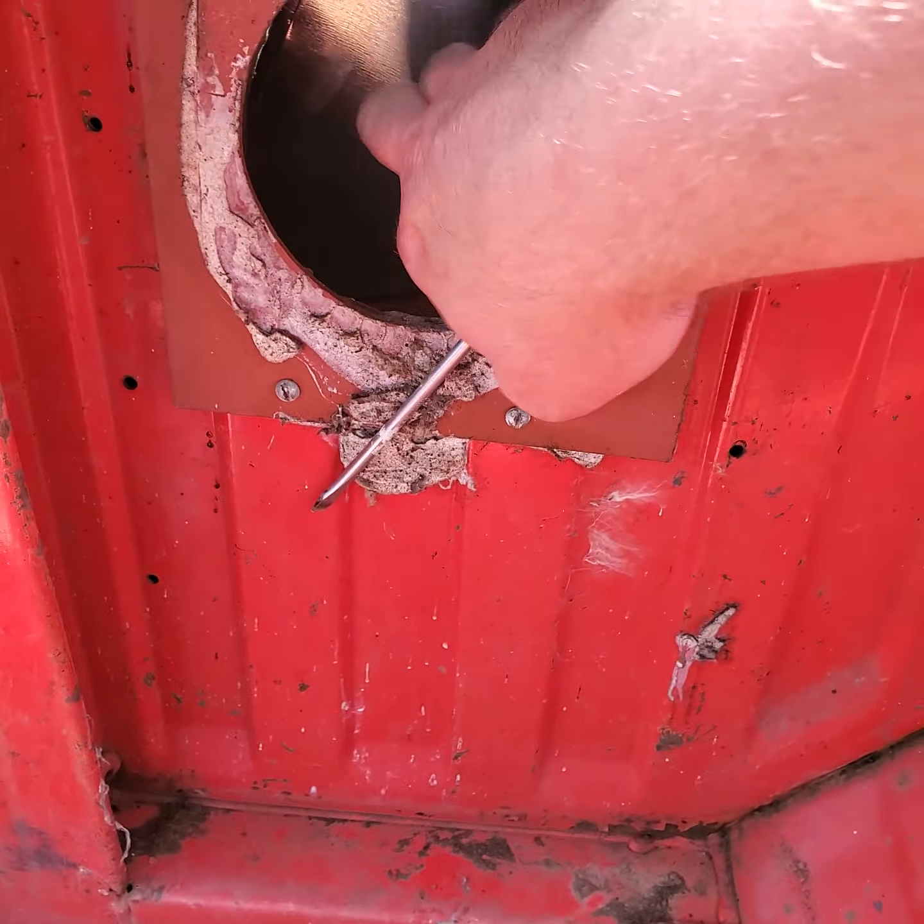There are actually stick-on floor pans, so I'll cut all that out, put the floor pans in appropriately, put new sheet metal in here, and then put a whole new piece in here, cover up that hole, right? Just cut out the rot, cover it. Same thing with that, cut it out, cover it. That's pretty much the extent of the rot in the cab.